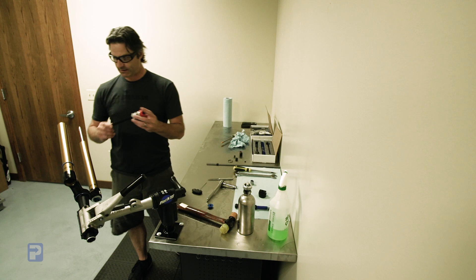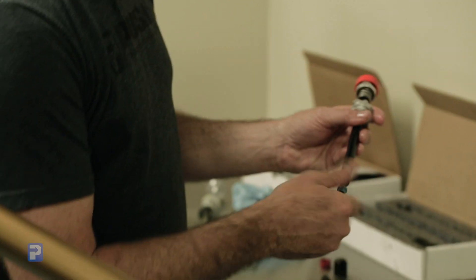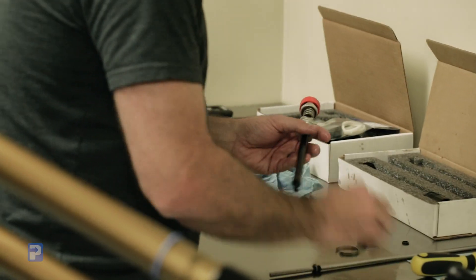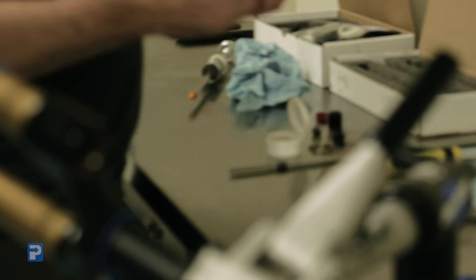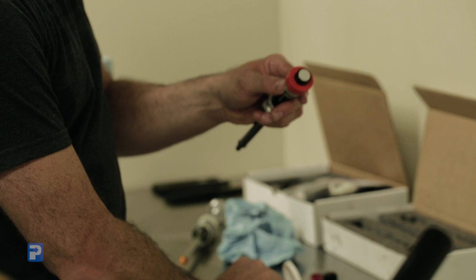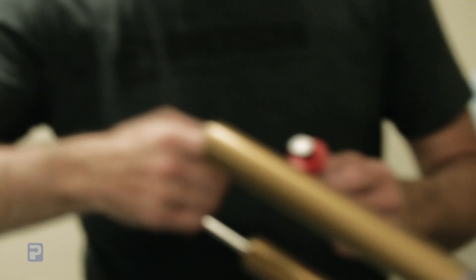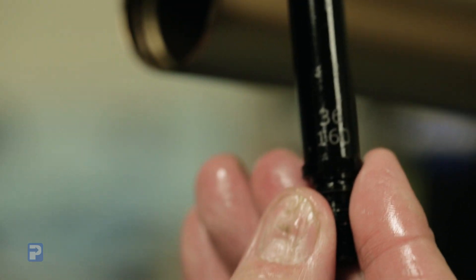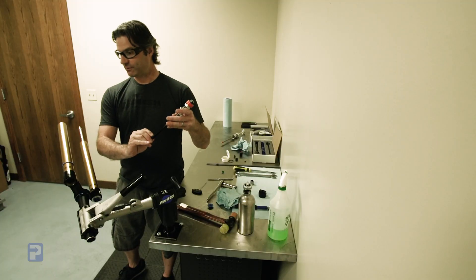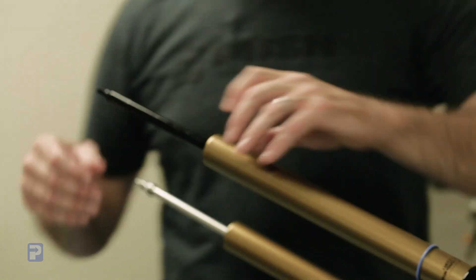The next step, we're just going to keep going with the chassis. In my conversion kit is an entire lower rod assembly. There's a fresh crush washer and a new foot nut that we're just going to take off. In our service kit there's a little packet of SOS lube — put a light film of that lube onto the lower spring perch and also a little film on the inside of the tube. The fork model and fork travel are laser etched onto the bottom of the post — this says 36, 160, so it's for a Fox 36, 160mm travel.